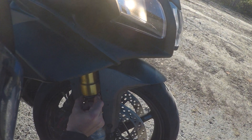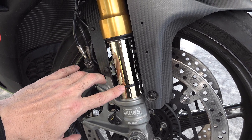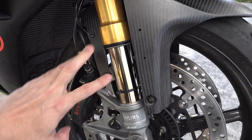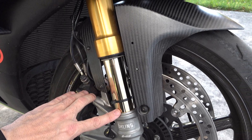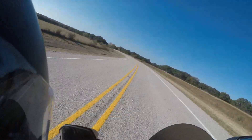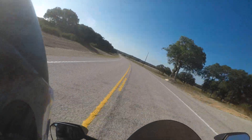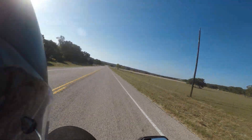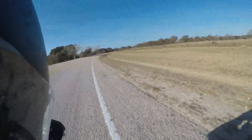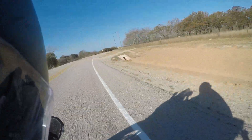Before the ride you push the zip tie all the way to the top, and now that I'm back home I can see it didn't come anywhere near bottoming out. Granted this may not have been the most aggressive ride with cold roads and cold tires, but I'm still well ahead of bottoming out — a huge improvement over before. Most importantly, the bike felt awesome. Going through those high-speed sweepers there was no instability. I can't believe how three millimeters of difference on that rear shock jacked with the geometry so badly. I should have swapped those springs a long time ago instead of fighting with it, but it handles great now — better late than pregnant.